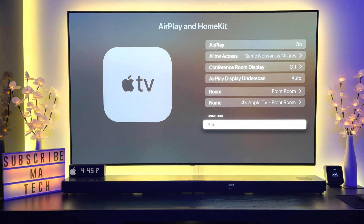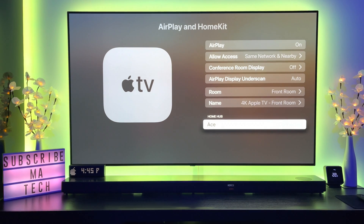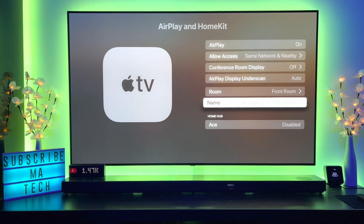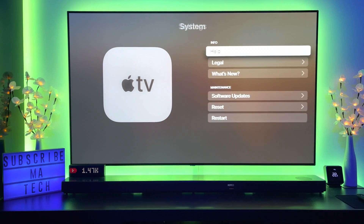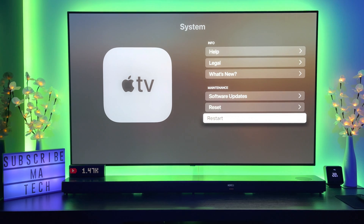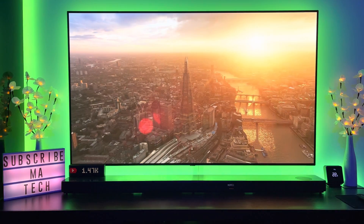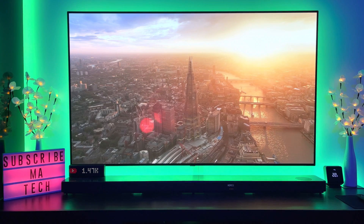Basically what was happening was none of the devices were actually being switched on and utilized. You can usually tell this because toggling Wi-Fi on and off usually fixes little niggles — if that's not working, it's probably one of these settings. More than likely it'll still say 'connected' on the TV but won't actually be functioning. What you want to do is toggle it — disable it, re-enable it — then come down to System and restart from there. Don't hit reset by mistake, but do restart. Once you've done that, it should be fixed.